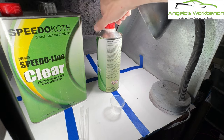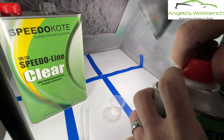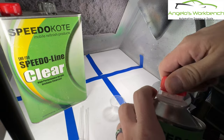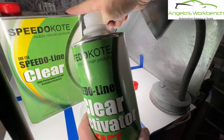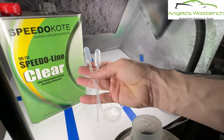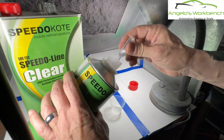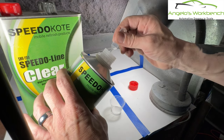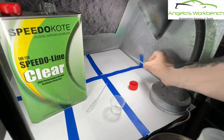It's time to mix up the clear coat. My cheapo clear coat from Amazon — I've been using the same stuff for five or six years. We're going to mix up one and a half batches: four parts clear to one and a half parts activator. I've already turned on the spray booth because it stinks. I've got two brand new pipettes ready to go. So I want one and a half of the activator — just eyeball the half.